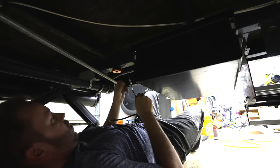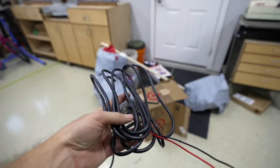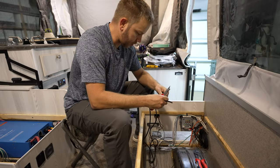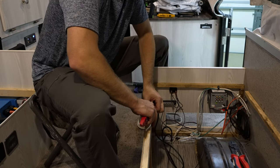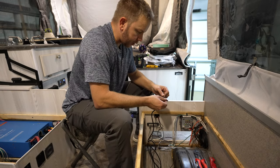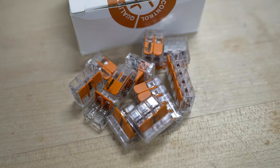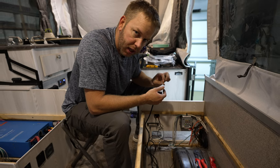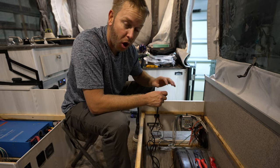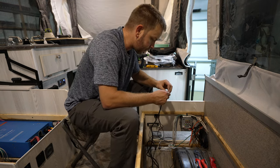The second light is going to go in between my drawer and my shower sink. Just got done cutting off the excess wire. I'm going to wire these up with some extra wire and then rewire them. The negative wires will get terminals and go to the bus bar. The positives are going to use these little WAGO — W-A-G-O — connectors. You pull these up and snap them down; they're extremely easy and reliable. I'll have links to all the materials in the description.